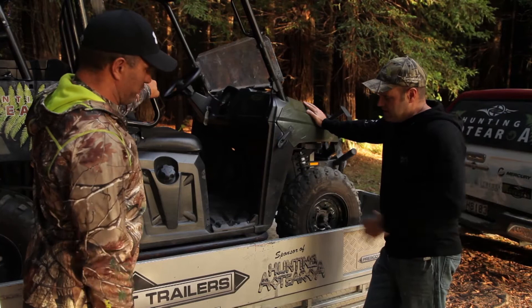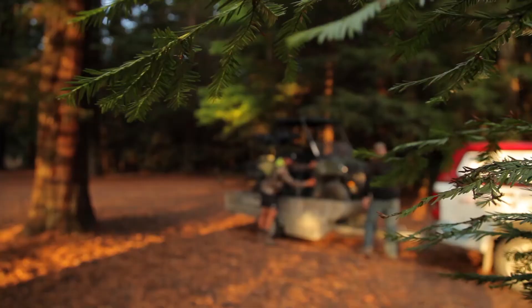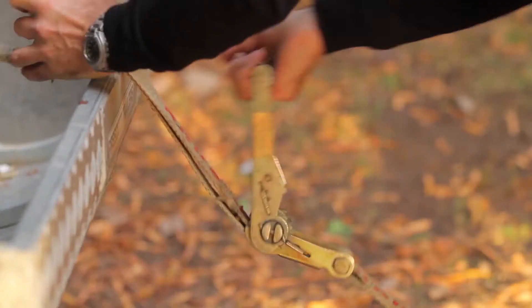Okay, so how's our Polaris sitting on our Prescott trailer looking? As you can see, the trailer mate, it's sitting right over the axle — it's not going to fix the problem. So what we need to do is put a portion of the weight of the Polaris forward on the trailer and on the drawbar. Alright, I'll push it forward.